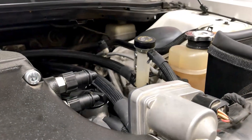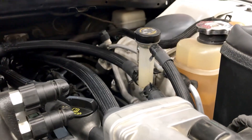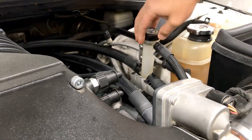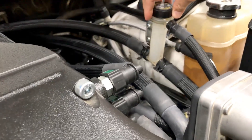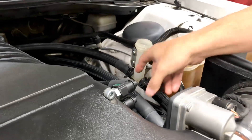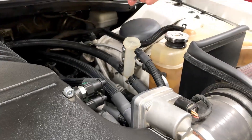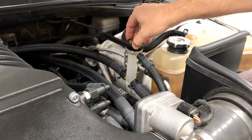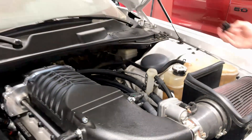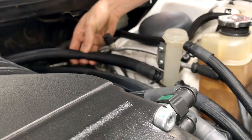You can hear a little less cavitation this time, and we're going to go ahead and turn the key off and remove the cap to burp it again. We're just going to continue to fill it to the top until that air gap is completely gone. Each time you remove the cap with the key off, you fill, then put the cap back on and turn the key on — that circulates the system and pushes the air around. Another trick is to sometimes squeeze the hose, which will release some of the bubbles as well.